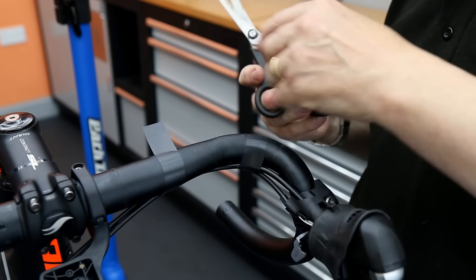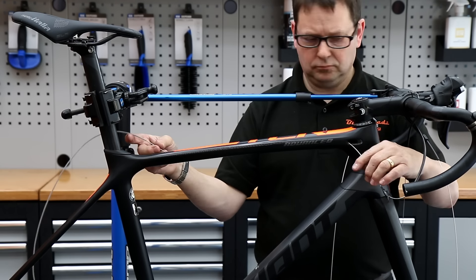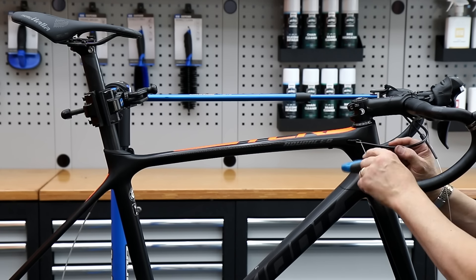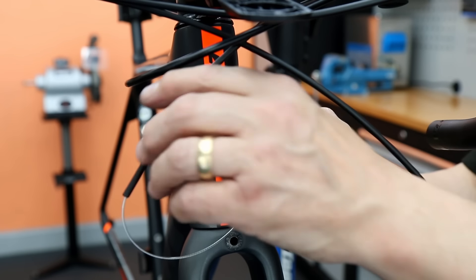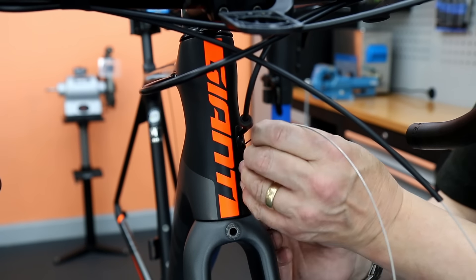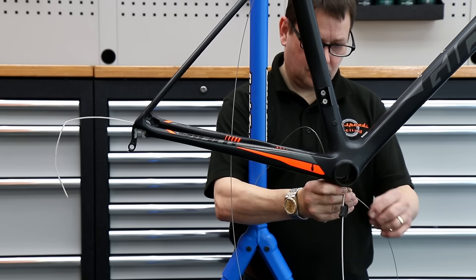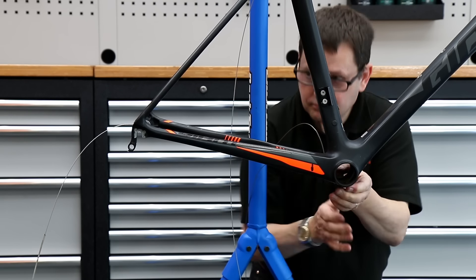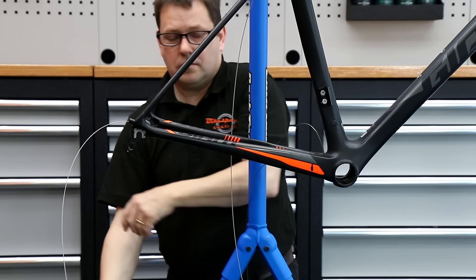First off I'm going to pop the rear brake cable through the frame — we've got those little frame fittings that need to be tightened up before the cable goes in. Then the derailleur cables — front and rear — they have their own fitting on the frame. The inner housing for the cables was nice and free with no blockages, which is good news. I'll then use a cable guide to get the final one in through the bottom of the chain stay and out the back of the bike into the rear derailleur, with a little bit of outer for the rear derailleur as well.